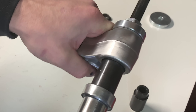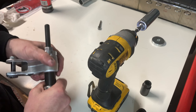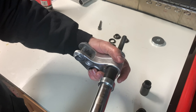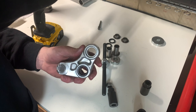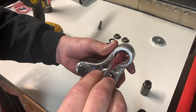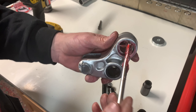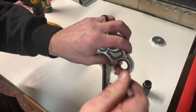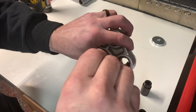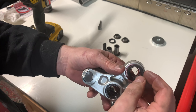You can use a bench vise with sockets too, but this is so much quicker. I'm going to go in just past this little white dot right there. We'll take a look and see how things look — should be pretty close to the center. Then pack a little grease in there; this will obviously grease the bearings but also helps hold these stupid roller bearings in. Put a lot in there — this might be the last time you ever grease these, you lazy bastard.